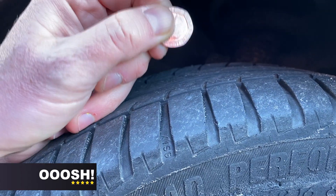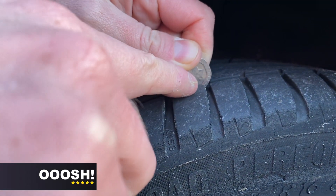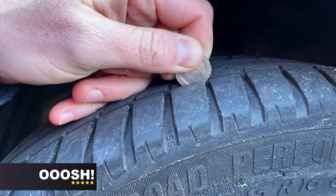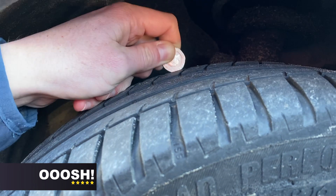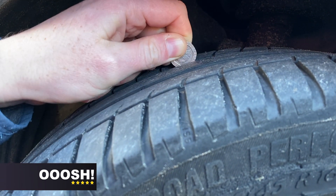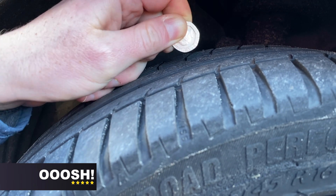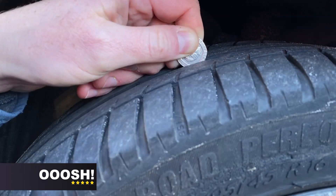Let's go outside and have a look at my tyre. Put the 20p into your tyre tread. Now what you're looking for is for that band to be completely covered and go right the way across, all the way across the tyre. You can see there, there's plenty of tyre tread — that's telling us you've got more than 3mm going across that tyre.